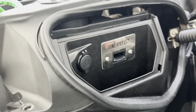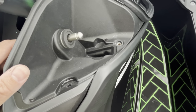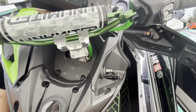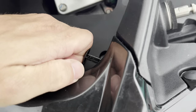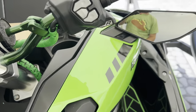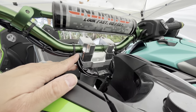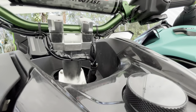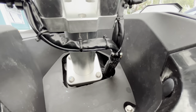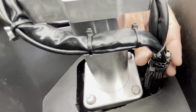If you have never had this glove box out before and never taken the ski apart like this, you might fight with it a little bit. Let's get everything bolted back together — the installation of the Unlimited PWC grips, end caps, handlebar, and riser will be complete. You're now ready to reattach your cover, and our immobilizer install is complete. How you manage these wires is really up to you. I've got some smaller zip ties holding the harness together and larger zip ties attaching it to the handle, plus a piece of expandable three-quarter inch sheathing right at the junction where all those wires come together, zip tied as well. The temp sensor right there just needs to detect ambient air to be accurate — put that right there and zip tie it into this harness.